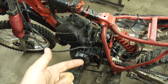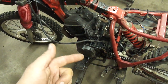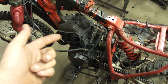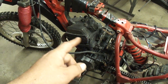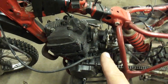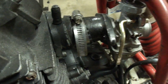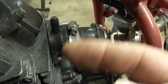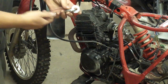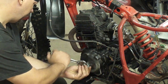The next thing I want to do is take the plug out of here and the plug out of there, take this cam cover off, and check to make sure that the cam timing is actually in spec. Hopefully that's not a big deal because these have Phillips screws — technically they're JIS — and they're kind of stripped out so I might have my work cut out for me just to get that cover off. But I've got to check to make sure the cam timing is correct. More than likely the reason why this bike won't run is probably because of this carburetor setup. We've got a carb into a boot, into a boot with some tape and some clamp. This is more than likely the problem, but we'll keep going. The best way I've found to get these slotted plugs out is to just use a big washer and a crescent wrench. It wasn't even tight, so that's good.